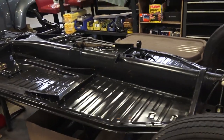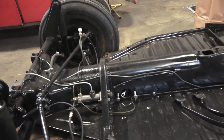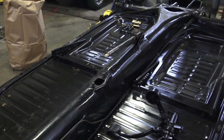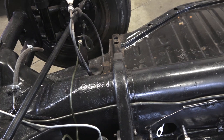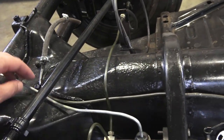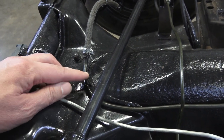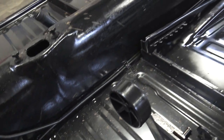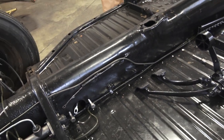I also wanted to point out — since people are asking about fuel line placement — this car needs a new fuel line because the one running through the tunnel is frozen solid; we can't blow through it. So we got some new steel fuel line. What we're doing is we drill a hole here, insert the tube, put our own tab to hold down the fuel line, and run the fuel line along the brake line. That's an option if you need to run a new fuel line.